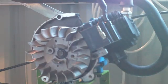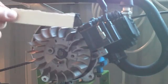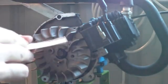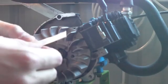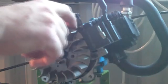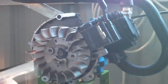Now what we're going to do is we're going to take this piece of business card from some sort of a business. All their cards are pretty much made the same — some are thicker than others, but this is a thin card. And what we're going to do is slip it in behind here, in between the magneto and the flywheel points. So I'm going to set that up now.